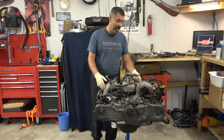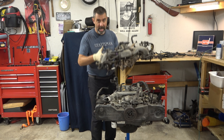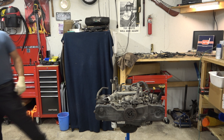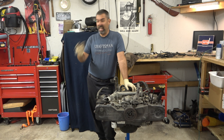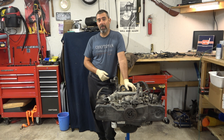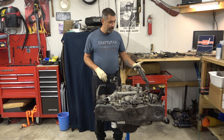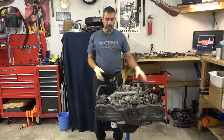Let's do this thing. I've got this unbolted, all my plugs undone, and I'm just going to pull that up and snake it out. There it is — our whole intake with fuel injectors. You can leave a lot of this stuff together; I'm just going to lay this on the ground. If you're working on a Subaru EJ engine, that's the best way to go about it because you don't have to take all that stuff off individually. The more stuff you take off, the more chances there are that something goes wrong — break a bolt off, cut a wire, or forget to plug a wire back in. You've got two vent lines and some cooling lines; I left those attached. You could take this off if you want to, but it's not in the way of doing our head gaskets.